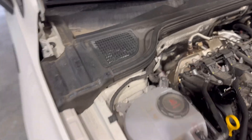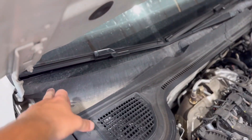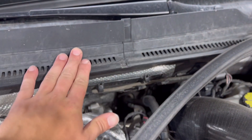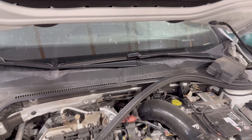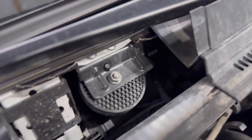We're going to come over to the passenger side of the car. This is how we're going to access the sound actor. We're going to remove this cowl panel and weather strip here - just kind of pull it back just like so. This is going to pop up. Be very careful with how it goes into the windshield; if you push too hard on it going back in, you can crack the windshield - I've seen it a couple times when I did windshield repairs. We're going to slide this guy out. The sound actor should sit right up underneath that wiper arm and we should be able to just plug into it. This cowl piece is now out of the way, which is going to give us access to our sound actor - this is going to be our sound generator, translated from German. That's where this harness is going to tee off of and that's where we're going to pull our power for our unit.